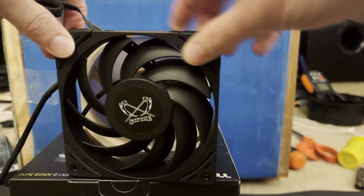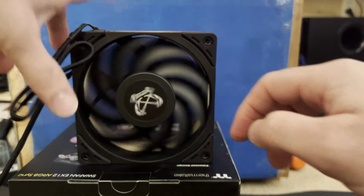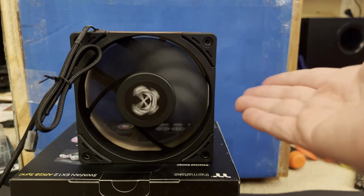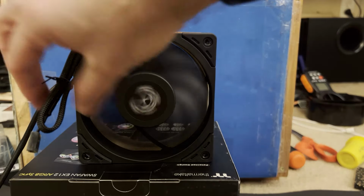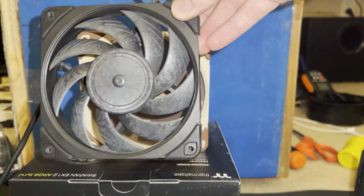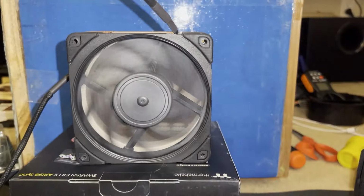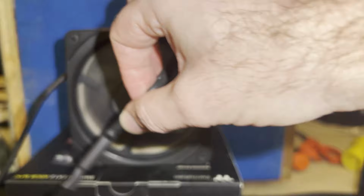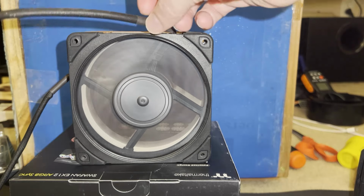This is completely unplugged. If one fan stops working and they're together, there's a potential for the non-functioning fan to just spin by itself. So notice the Noctua is pulling the air to the non-powered Scythe. So this is a risk. You're doing the same thing with two Noctuas. Put them together, and the same sort of thing happens where the Noctua will spin. And again, notice, completely unpowered. So that means that this could draw current into your system and cause damage.